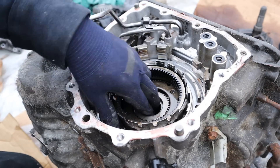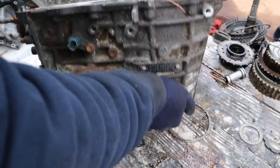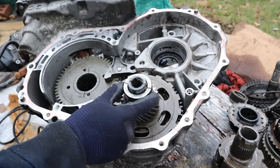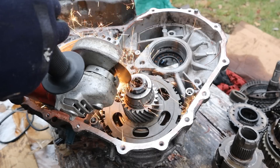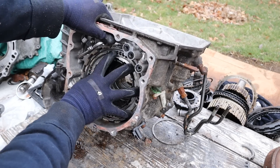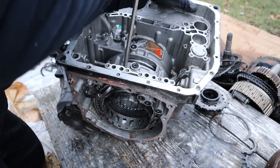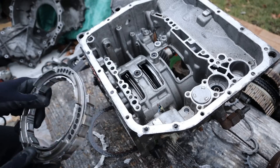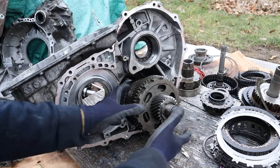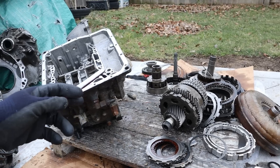This Toyota transmission is so easy — you can just take it apart with screwdrivers. I can remove this planetary gear set, there's a thrust washer and another set of sun gear over here. I'm going to keep pounding with a socket until something happens. The planetary gear system — even this planet carrier and ring gear suffered a lot of burns from the fluid. I'm going to try to cut this bearing off so I can pull off the gear set. What I'm trying to get is this cage out, but it's held captive by a ring pressed into the aluminum that controls the hydraulic piston behind it for the clutches. After a lot of beating I'm going to break this thing out. There's the piston — press fit onto the aluminum housing. The clutches sitting in here are actually pretty good. The last piece to pull out is the counter shaft — we've got the sprag bearing out and an anti-rattle clip. The entire transmission is now disassembled.